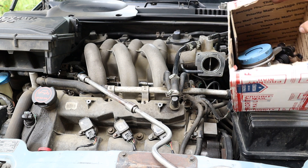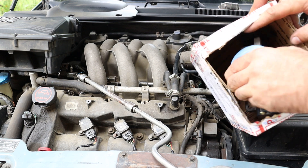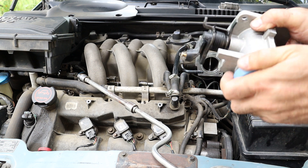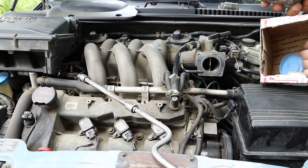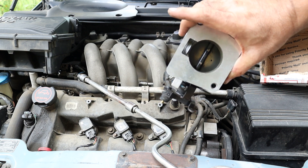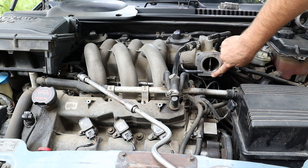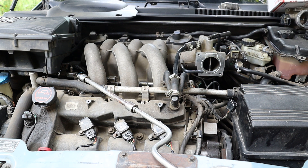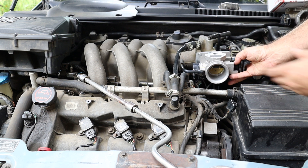I've got my new throttle with a new throttle position sensor, which turned out very important — it added to the performance of my old engine. I gave grateful feedback to the eBay seller where I bought this part. When installing a new throttle, one should replace the throttle body gasket, but mine seems to be in good condition, so let's leave it where it is.